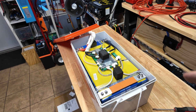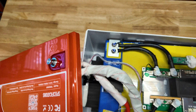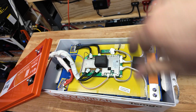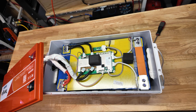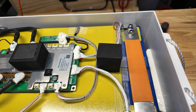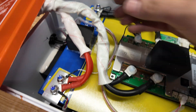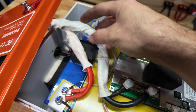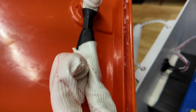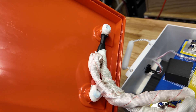I tried to pull the whole assembly out, but on the bottom there's double-sided sticky foam — they stuck the battery on that and glued two big pieces of foam on the sides to secure the pack. I won't be able to pull it out, unfortunately, but the build quality looks pretty good. I'd be very confident using this long term. The positive wires are also two six-gauge wires, with insulation wrapping to protect from chafing and heat. Terminals look nice with sealant applied after torquing.